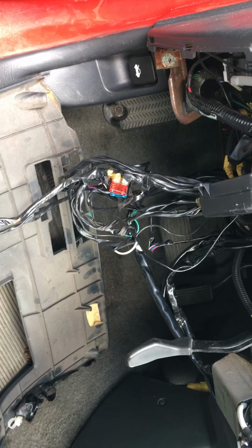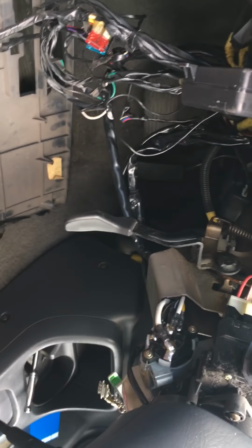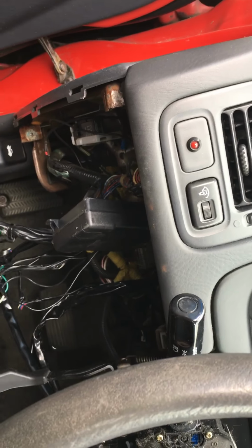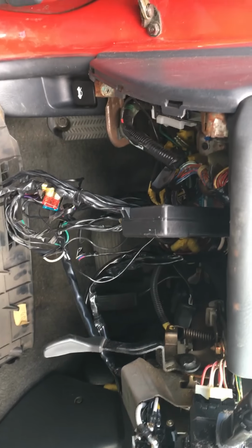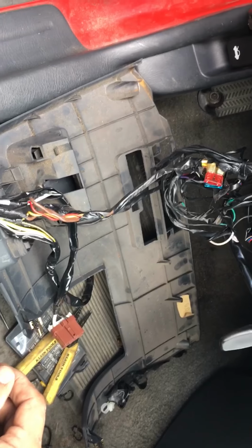It has to be an immobilizer. And well, it's the ignition key, but again, I'm not 100% sure if the immobilizer is the real problem in here. When I bypass it by connecting the brand new ignition key unit, it works. So there's not a problem with that. Car starts, I got clusters. Car starts, no problem. So should I install it, should I not? I don't know. I'll think about it, and maybe I'll do an extra video and say, yeah, I did it, and it's working fine. So maybe it's not the immobilizer. Easy way to test it again, the way that I did it, is by just connecting the ignition key harness directly to their positions without cutting any of the cables and connecting any of the immobilizers.